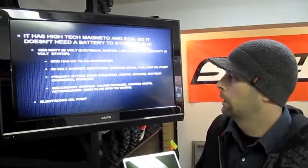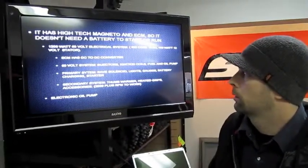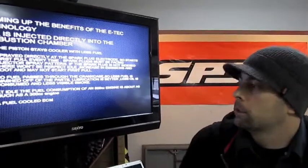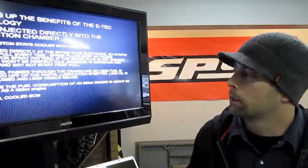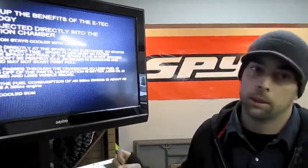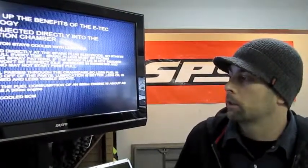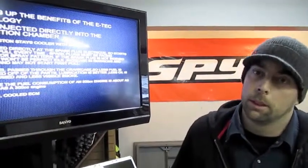You don't have to worry about adding oil to the fuel for break-in or adjusting any cable because it no longer exists. Everything previously discussed is controlled by the ECM. The machine has lots of sensors throughout, relating to all the different functions the motor can perform. One unique thing about the ECM on this machine is that it's fuel cooled — it gets very hot with all the functions it carries out, so fuel is run through the ECM to keep it cool and running smoothly.